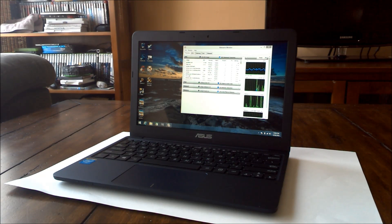You do get some great pricing, and it is comparable to tablet pricing — that's kind of the market segment I'm focusing on. The internals of this mini laptop are what you'd find in a lot of tablets: it's a Z3735F processor, a Bay Trail Atom, clocked at 1.33 GHz which turbos up to 1.83 GHz. Running games, it seems to hover mostly around 1.5 GHz as its operating speed. It uses Intel HD graphics, the same as the tablets out there.